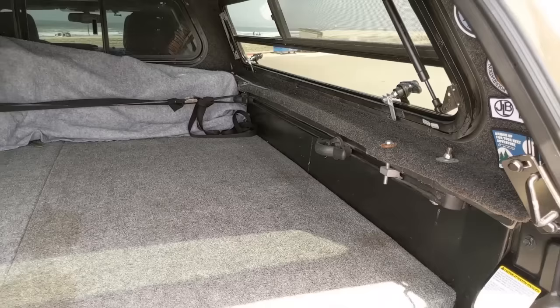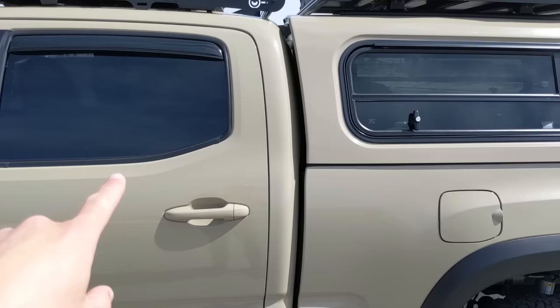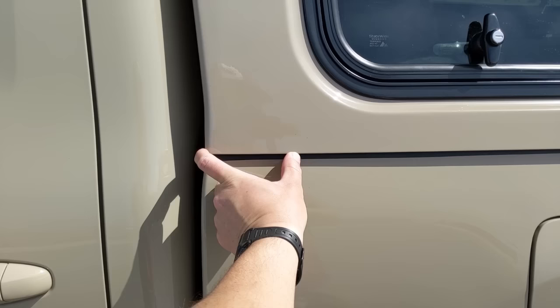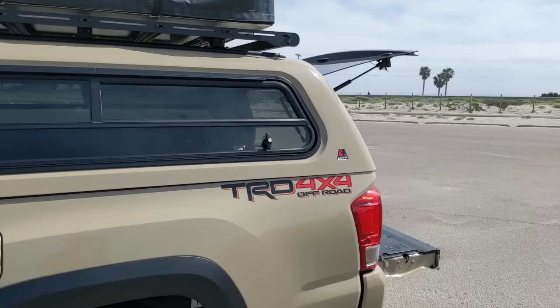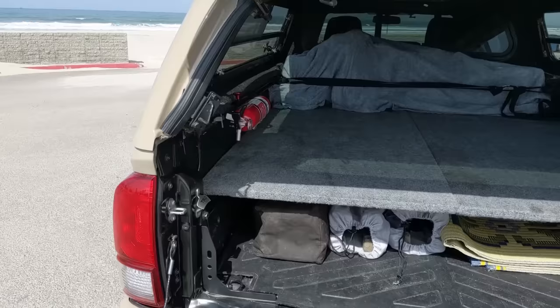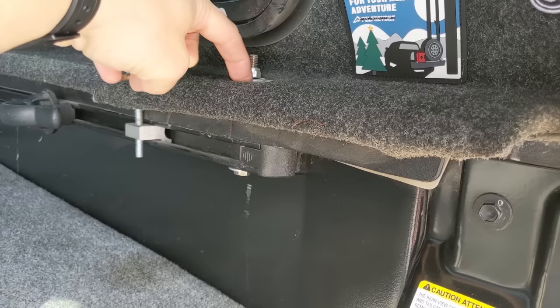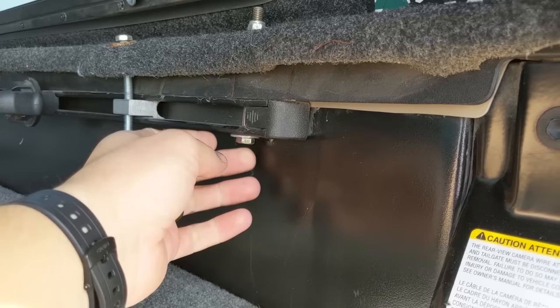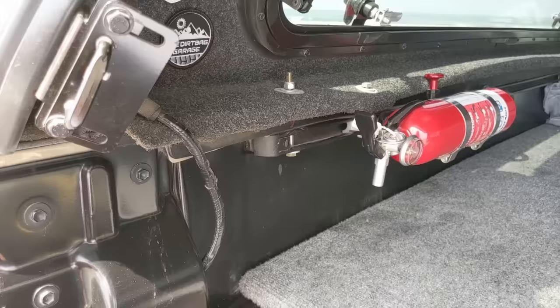What happened was we went to Death Valley, were off-road driving on a road for about three miles going slightly upslope, and when I got out of the truck and came around to the side, the shell had slid back about this much. That scared the crap out of us because we had the tent up top and all our stuff inside — we almost dumped our $2,300 shell off the back of the truck. All I did was loosen those bolts, push it forward back to where it was, tighten it down, and we didn't have a problem the rest of the trip. When we got back home, we had the dealer drill through the top of the shell, through the top of the bed rail and the rail, and now there's a bolt that goes through on both sides securing the shell from moving forward or backward. We haven't had that problem since.